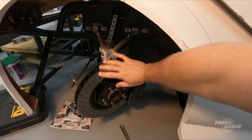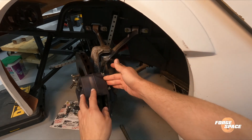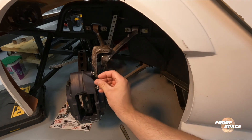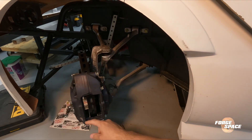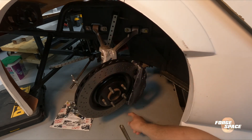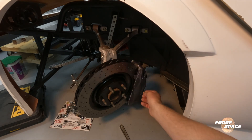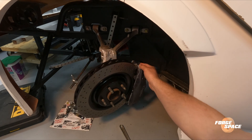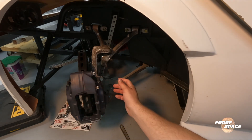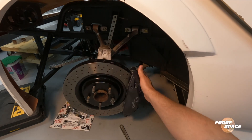As you can see, these guys are fairly hefty. The bolt pattern is the same for mounting it back here. There is a spacer that needs to go on the backside — it is about 40 thousands just to get it centered. Then all you have to do is grind down this little upper portion right here and the bottom portion to accommodate it enough where, when you get thermal expansion and the rotating force, you have enough clearance. I'm not too worried about the look of this because I'm going to spray paint this with brake caliper enamel in a color that's going to match the paint downstream.